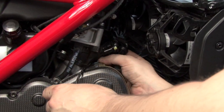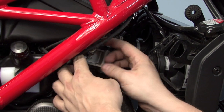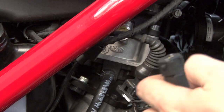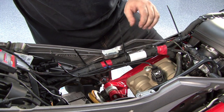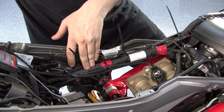I'm also going to find my crank position sensor connectors right here, just to the right of the front throttle body. I'm going to disconnect the stock crank position sensor connectors and plug the Power Commander in line with those. Before I start reinstalling the fuel tank, it's important to go ahead and tie up the harness directly on top of the stock harness.